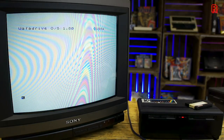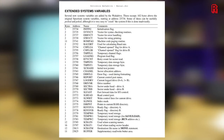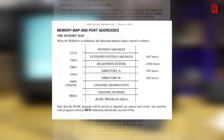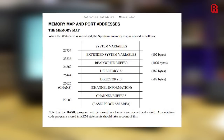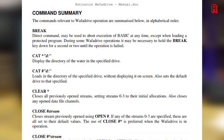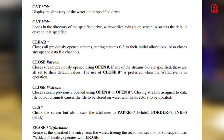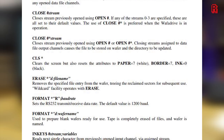We've got version 1.80 here. What it's done is reserved about 2K of the Spectrum's 48K of memory to hold system variables, a read-write buffer and various other overheads for its operation. It doesn't occupy a full 8KB of the Spectrum's memory because it functions by paging out — that is, it intercepts errors from the BASIC interpreter. So if you type in a command like New Asterisk, which the Spectrum doesn't understand, the Wafer Operating System intercepts the error, interprets the command and acts upon it. It's a nice memory-saving approach.